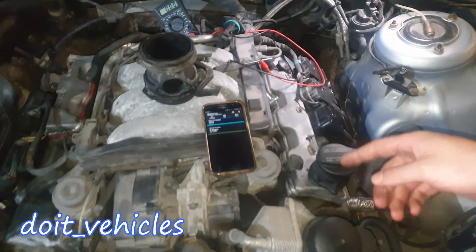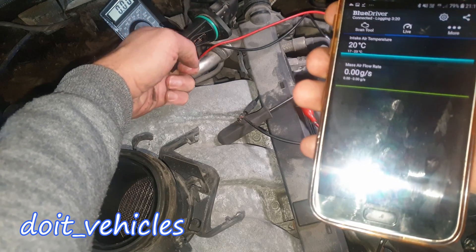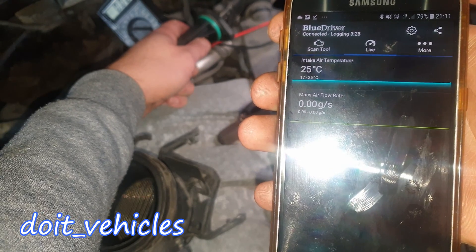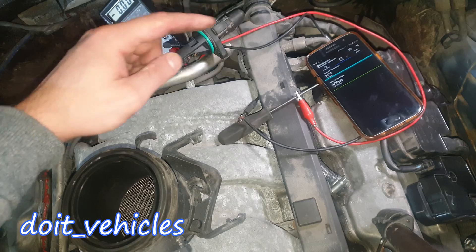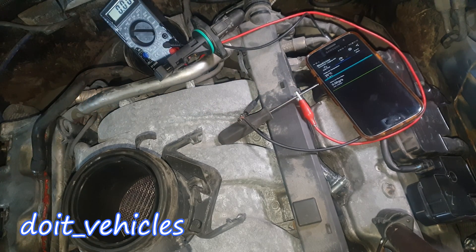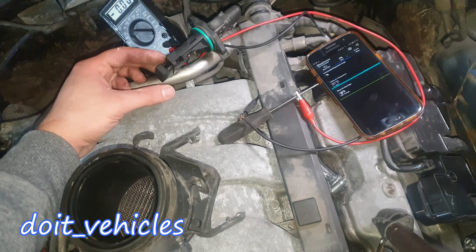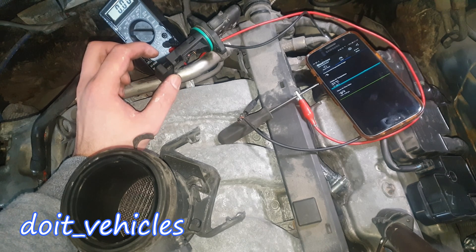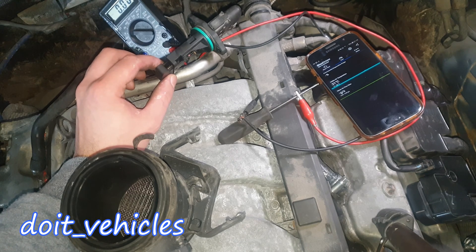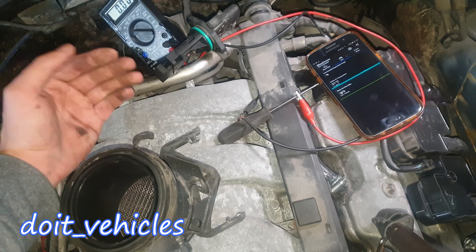Now I've got the scan tool connected and the sensor connected. I want to see if the sensor will react when the engine is not running. If I touch the sensor a little bit you can see the temperature increase - it will take my body temperature. However, on some cars if you blow on the mass air flow sensor you're going to see some readings even though the engine is not running. There is no change in mass air flow rate. The sensor can read the air which enters the engine but this doesn't mean the measurement is accurate, because those hot wires can be covered in a very thin layer of debris, oil or dust, which can prevent the thermal loss of those hot wires and mess up the airflow readings.